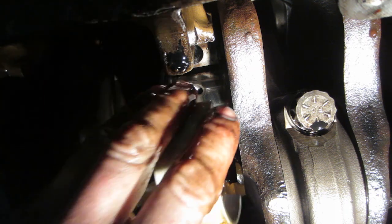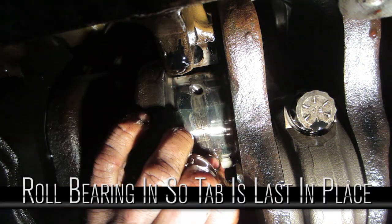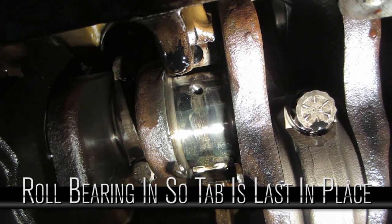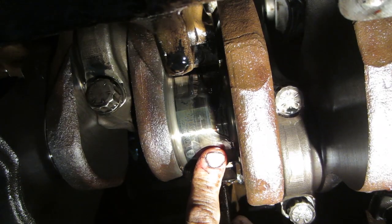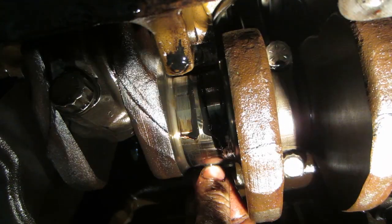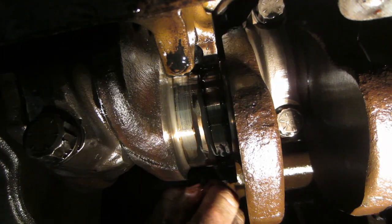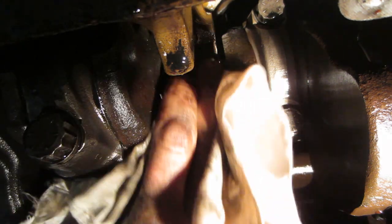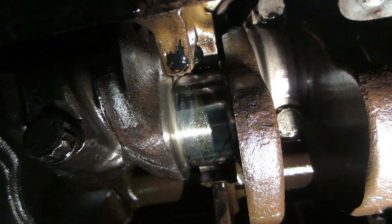Take a clean bag, dump the new bearing in clean oil. It's got a little tab on it, so you do have to start it yourself. Sometimes you can roll it in entirely by hand, but it gets tight, so then you can use the set screw to roll it the other way. You can even have the head stick out further — see the bearing poking through there? Perfect. Now pop the bearing on the bottom half, put the cap back on, and you've got a nice tight bottom end ready to take another beating in the field.